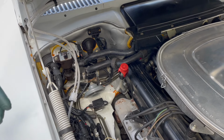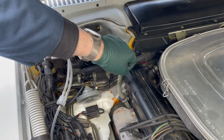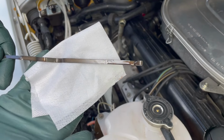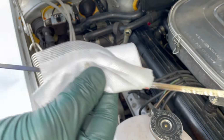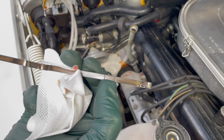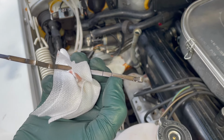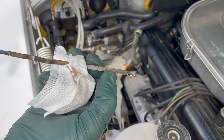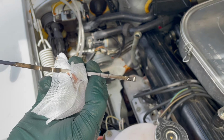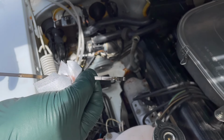When you've completed the power drain, the next challenge is to get the transmission filled properly. And I think most of you know you can't check transmission fluid with the engine off. But for those of you new to this, I'm going to show the marks. I always use lint-free cloths when I'm wiping these dipsticks. So there's your marks. That mark is cold and this mark is full hot. What I do after I complete the drain is I put it right about here. It's not going to hurt to drive it for a little bit. Make sure you put a few miles on the transmission, then come back with it warm, and then you can fill it up to here. In any case, I try to go halfway in between. You don't need to get it right to that top mark.